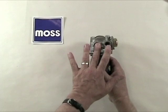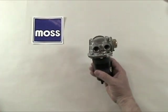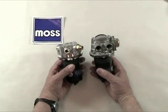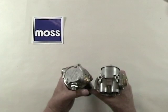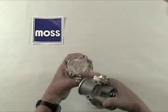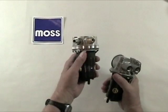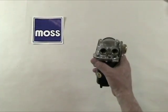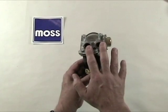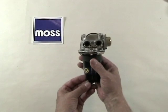The use of the 377-161 pump opens another door of possibility. Can you see how these two pumps are similar in dimension? And they're also similar in volume. The only major difference aside from the fittings is the distance from here to here and from here to here is a little different, about 3/4 of an inch. So if you originally had a pump like this and you want to modify the way that this is bolted in, you can use this pump with the banjo fittings and get your car back to having an original SU fuel pump in it again.